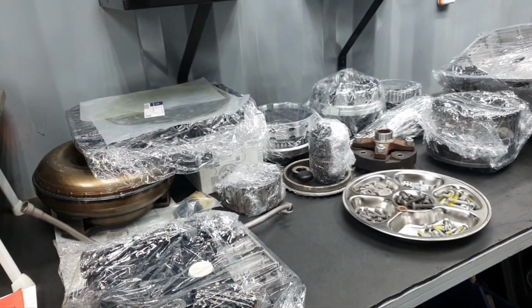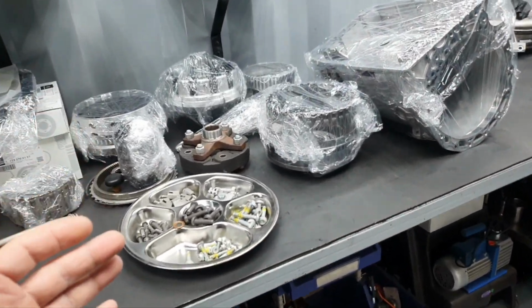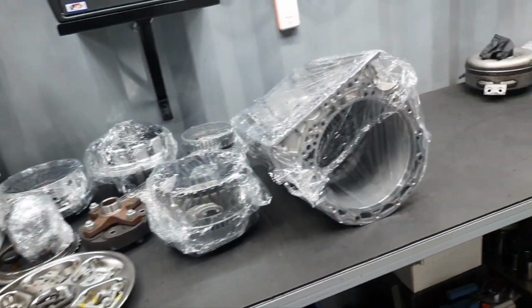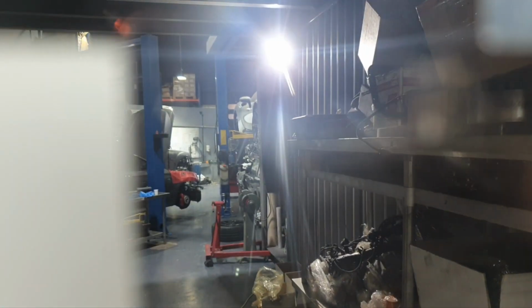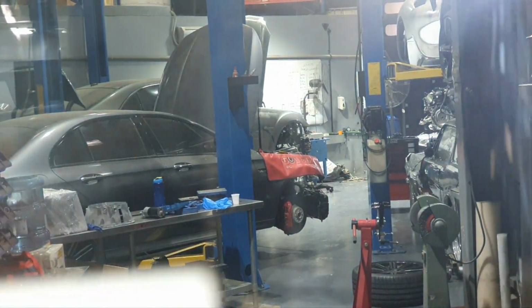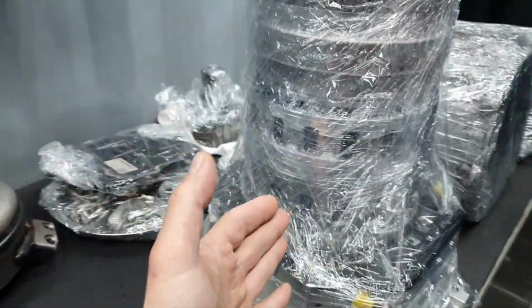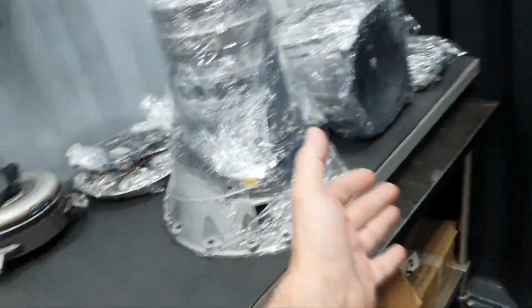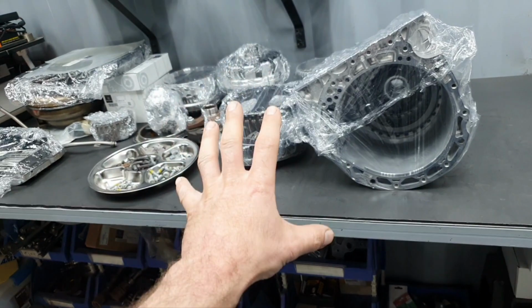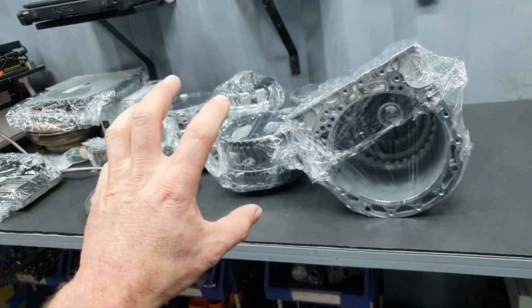All right, so what's the story here? The SL55 is waiting for its transmission to be able to finish the car and release it. The S63 needs the guys to put the transmission and the engine in. The engine is still there on the table. The car is on the lift on the left, not the E-class, the S-class behind. Even if I had the parts, the planetary gear that's remaining for the 722.9, obviously I'm going to close it because I cannot continue with that, but ideally it's better if I have the parts for the 722.6, for the SL55, because that's what this car is waiting for.